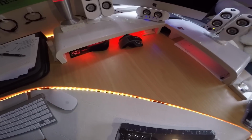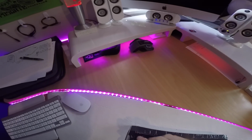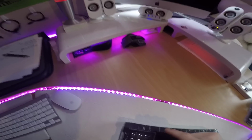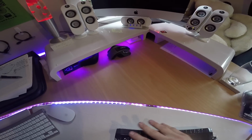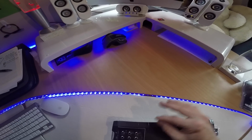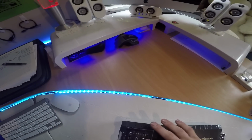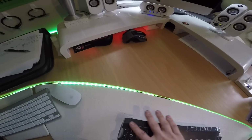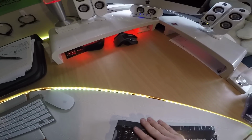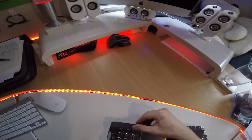On the front and rear channels, when you increase the EQ knob, you get basically more bass, more treble, and on the subwoofer channel, increasing the EQ puts a bit of a boost on a certain frequency. I'm not 100% sure which it is. I tend to not use these on amplifiers, whether it's Rockford Fosgate or anything. I tend to not ever use the built-in bass boost or EQ boost, because it's really just boosting up frequencies that is going to result in more distortion, so I tend to leave them.